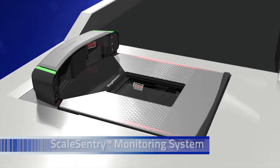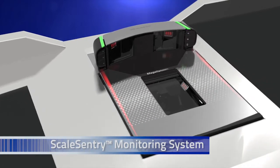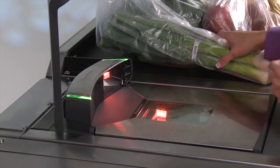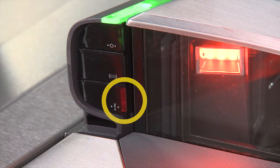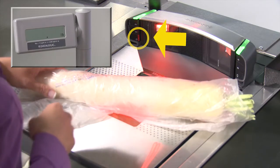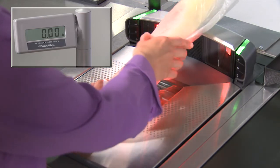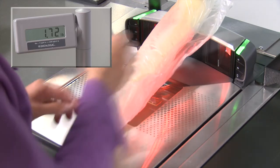The scale may be equipped with Scale Sentry, a feature that uses two invisible infrared beams to monitor the edges of the scale platter and detect items that are not correctly placed. If an item is incorrectly placed on the platter so that it breaks the beam, a tone will sound, an LED will blink on the bottom left-hand button, and the transaction will be stopped. Another way of knowing there is a weighing error is that the scale display will not show a weight. To correct the error, simply reposition the item on the scale platter or use the integrated weigh surface on top of the bonnet, and the light will go out and the weight will be sent to the system.